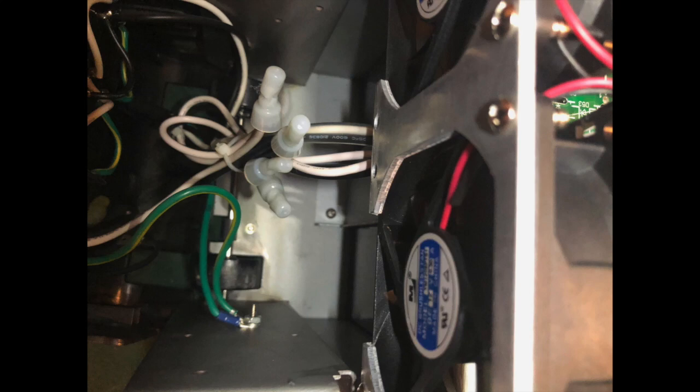To gain access to the batteries, you're going to remove the rear panel and the top cage. Now is a good time to remove the rear panel. Two things prevent you from getting it far enough away to have room to work: those two green wires held in place with a nut and bolt. I removed the nut and bolt, pulled out the wires, and put the nut and bolt back into the right hole so I'd know where to put it all back. I did not snip the tie wrap on the white cluster of wires, but that would give you more space to extend those wires and get the rear panel farther away.